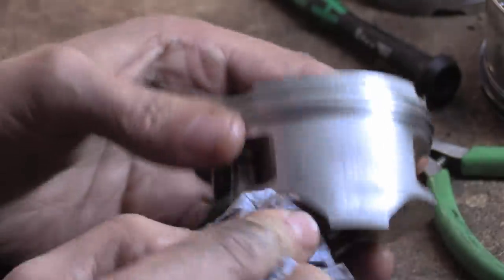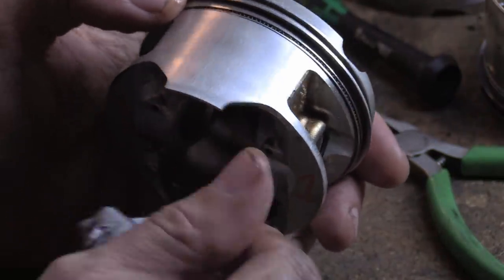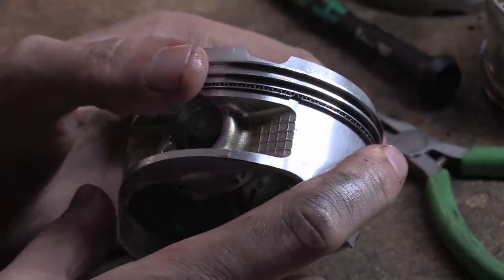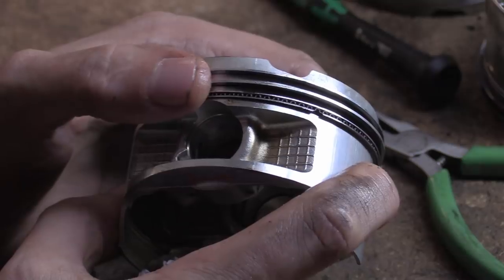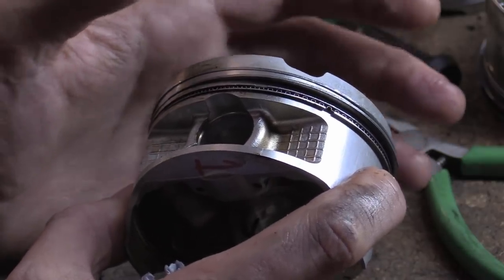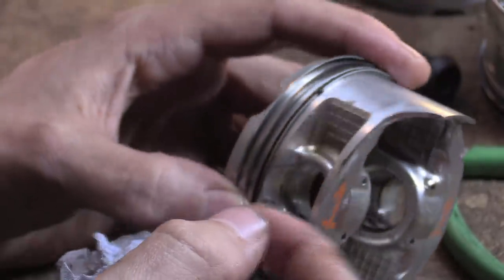It's just deposits — the waxes, the oil residue, bits of carbon. Scraping on this side skirt is exactly what I'd expect. This is why you measure. When you get a micrometer — we're going to do that soon — you measure at the side skirt because other places don't receive wear. So you aim for the place with the most wear when you're trying to measure the wear.